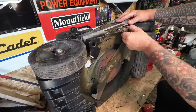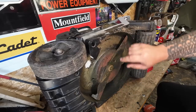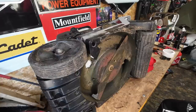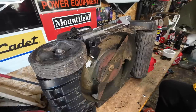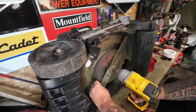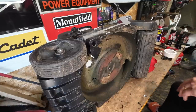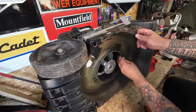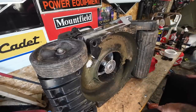It has got other faults as well - it's got a fault on the cowl. I might be missing some screws, we'll figure it out. I want to remove the front bolt off the blade - maybe about a 14. I've got a fan in the background going, guys - you might get a bit of noise, but it is absolutely red hot in the shed today. So undo that bolt, that comes off. Put that to one side, and then remove the friction disc. Now I'd like to try and remove this half cowling first - it's pretty much all hanging off as it is. There's a little tiny Phillips screwdriver in there.